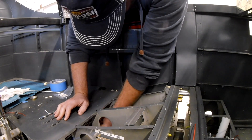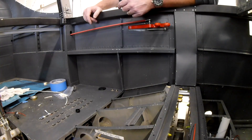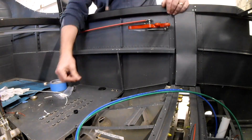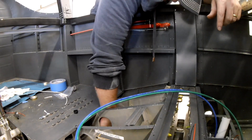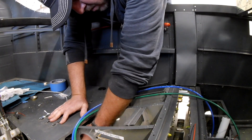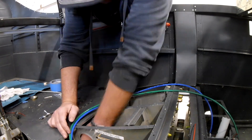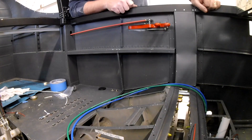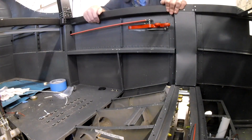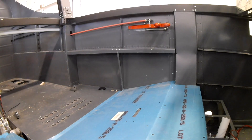We still have the wing wiring to deal with, but we won't deal with that for a while because I don't know how long to cut stuff. There you can see the blue and green vinyl tubing — that is for the pitot and the angle of attack coming out of the left wing. The wing box has holes drilled on either side of it. On the right side that's where your brake lines come through; on the left side I'm using those holes to put those two vinyl tubes in. Thanks to Vans for supplying holes to use.